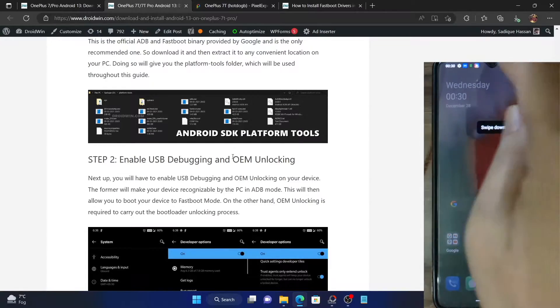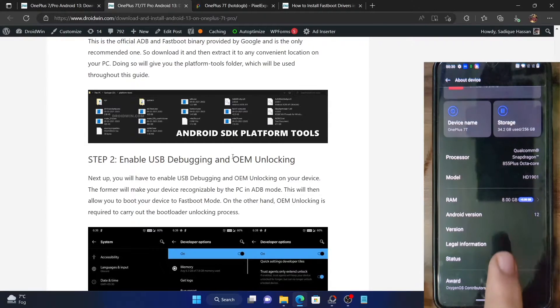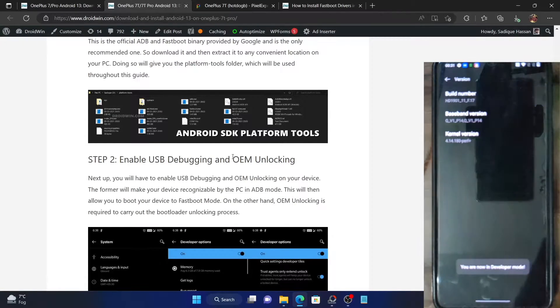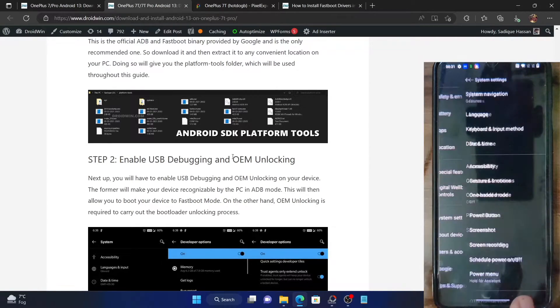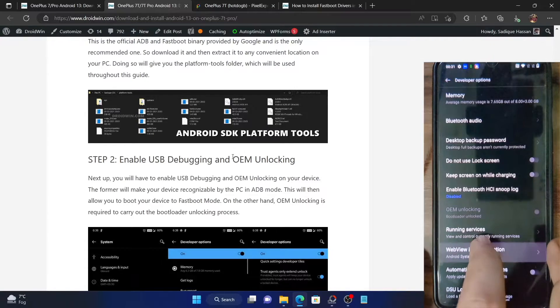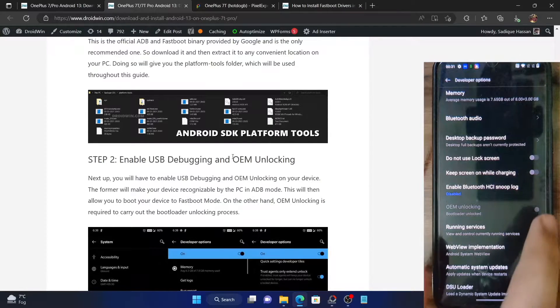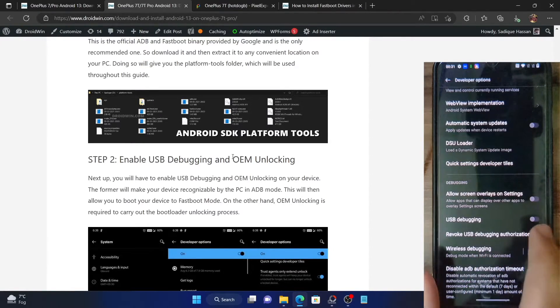Go to the settings menu on your device, then within the settings menu go to About Device, then go to Version and tap on Build Number seven times. You will now get a notification that you are now a developer. Once done, go back to System Settings and you should now see Developer Options. Go there and enable the toggle next to OEM Unlocking. After that, scroll down and enable the toggle next to USB Debugging as well.